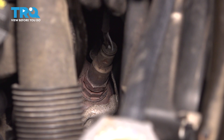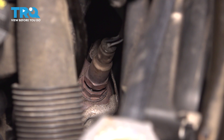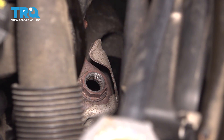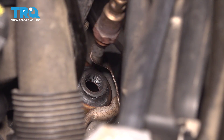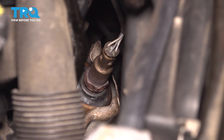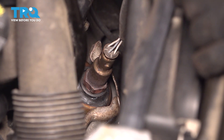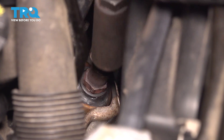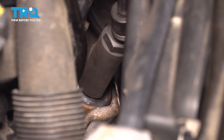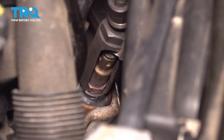Break it free. If you twist the wire, you should be able to twist the O2 sensor out of its port. There it is. Now let's reinstall this upstream sensor — slide it down in here and spin it onto its threads. If the threads are clean, you should be able to just spin it with the wire. Drop the O2 sensor socket back down and finish tightening this up — just squish it down a little bit so that gasket can seal up.